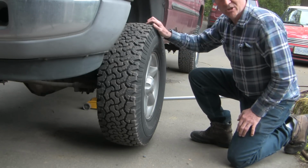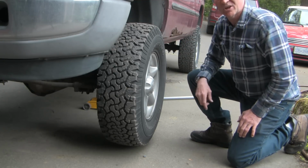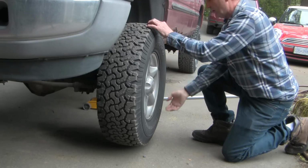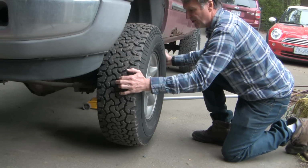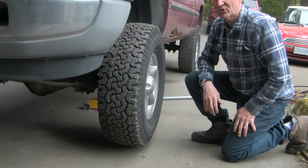Right now I want to check to make sure the wheel bearing is okay before I get started, so I'll be able to replace the wheel bearing at the same time if it needs it. Now this is a McPherson strut system, and so you do it with the wheel unloaded. You go to the 12 o'clock and 6 o'clock position and try and move it, and it doesn't move at all. And just to check, the tie rods are fine as well.